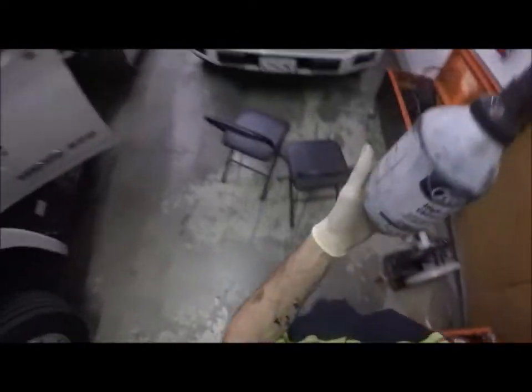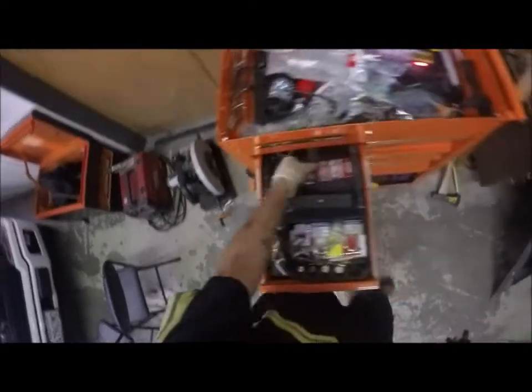All right. Don't hear no air leaks here. Let's see if we have any soap bubbles. Just for shits and giggles. Some soap bubbles. And let's see, do I have a flashlight? I need a flashlight for this. Here's a flashlight. Okay, so let's get up in here. The soap. Soap and water. And I just want to hit the inlet parts of the air fittings. Gonna hit where the hose goes in just to see if there's anything leaking. Bubbles will form pretty quickly, so I think we're good.